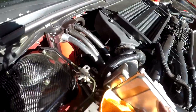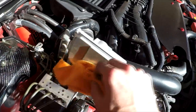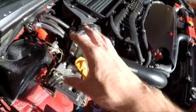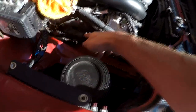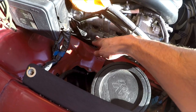Now with my ECU, I actually had to remove the two top bolts in the top bracket up here, and then the two nuts near the bottom. Since I have the AOS, my ECU is relocated and it's right in the way. So I have it propped up right here now, and that gives me access to cylinder 1 and cylinder 3.